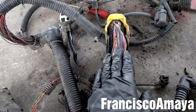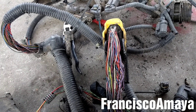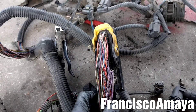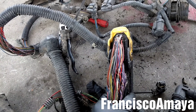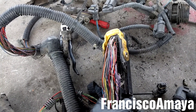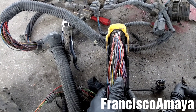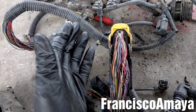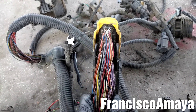This is the reason why it goes bad — it is not the oil. Some technicians and mechanics still believe the oil is the reason this harness fails. The injector harness inside the engine is running in direct contact with oil all the time and has no problems. But the engine harness outside is having issues — and if oil were really the cause, that doesn't make any sense.